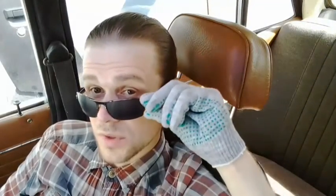Hello. The water pump is an important component of the cooling system and it should be checked occasionally. In my car, you can see that there is some clearance in the bearings of the pump and a metallic grinding sound is heard when the engine is running, so I decided to replace the pump with the original one.